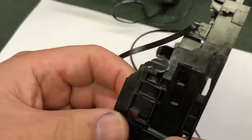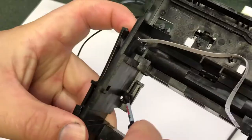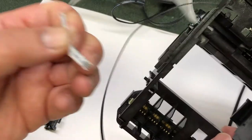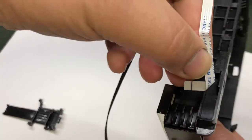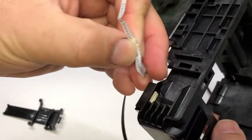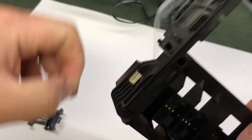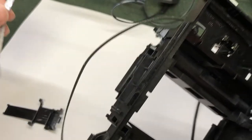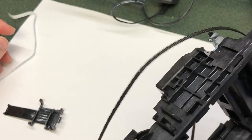It will lock in place. When you install, remember the shining part of the cable is towards your right, and the white part of the cable is towards the left or towards the outside. If you're not sure which side it goes, just take a closer look at the base. You can see the metal part is on the right — that's why the shining part should face right.